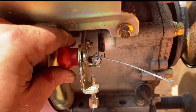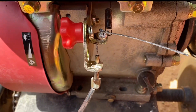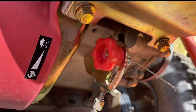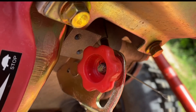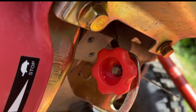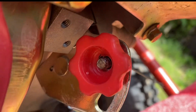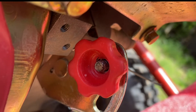That was something I had a little bit of an issue with — the little knob just kept coming off under vibration. Luckily I would find it each time, but what I did was I took some electrical tape, put it on the bolt, and then threaded the knob on over that, and that's enough friction to keep that knob from rotating off all the time.